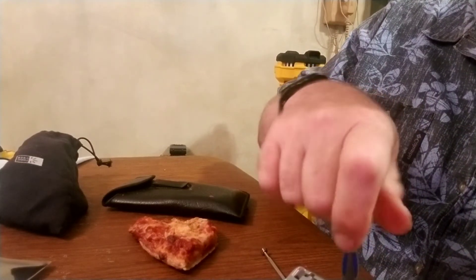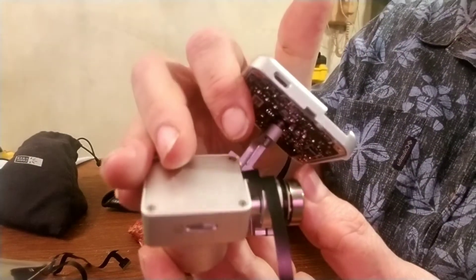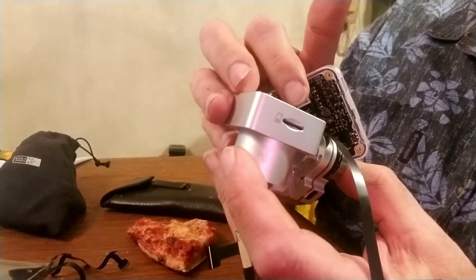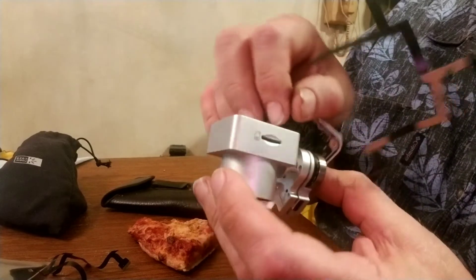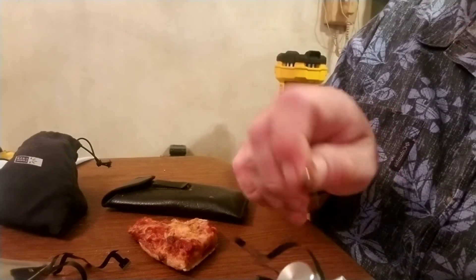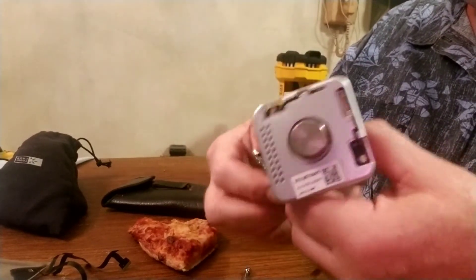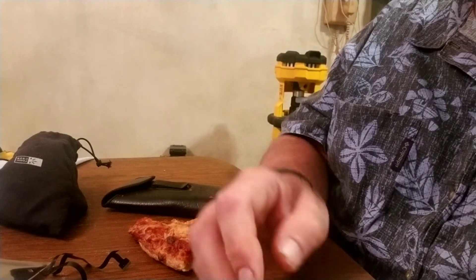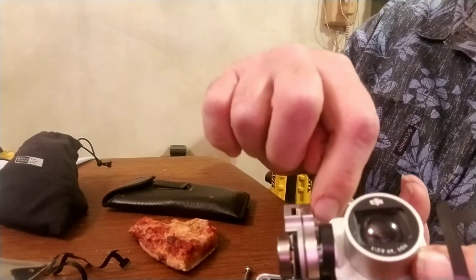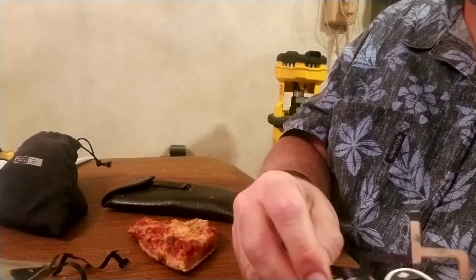Technically you don't need to take these T6 screws out, but it makes the job so much easier. This is a two-step jog here. The first part folds down flat against the camera body, and the second part — facing us — is going to fold down and cover the pivot screw for the camera. Fold this pivot down into the corner like that. Then this part will wrap around — one full time around the pivot. Now this part that comes around has the glue on it, and that glue is going to attach flat on the bottom part of the camera here, then up the side of the camera bracket and over the top into the hole where the fitting goes. We're going to pull it up and over and leave the glue on this time.